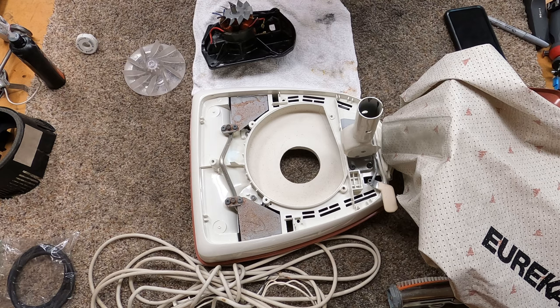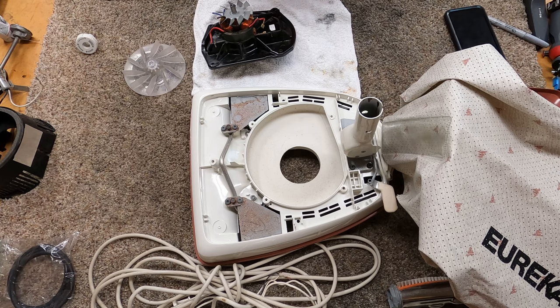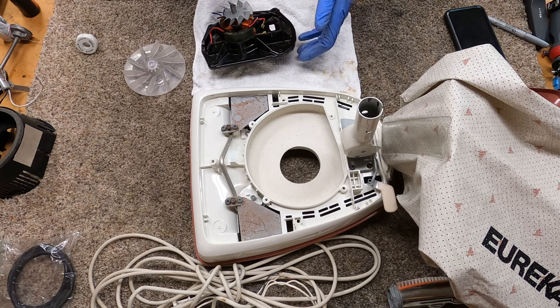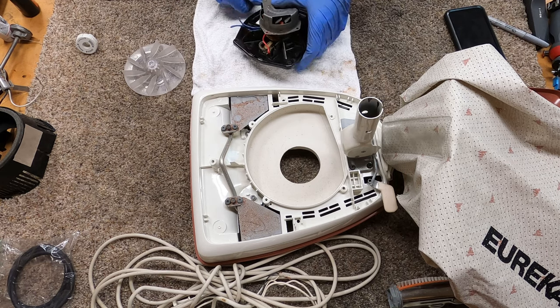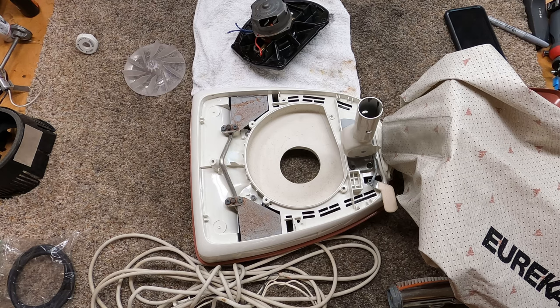Just a little bit — not much. Another option is some real heavy oil like differential oil. You're actually supposed to soak this bearing; it's meant to hold a lifetime's worth of oil supposedly, whether or not it actually does — that's another fallacy of service. We're turning this upside down so the oil goes into the holder for it. That's going to go on just like that, and then it just screws in here. This is a bakelite housing, so do be careful with it.